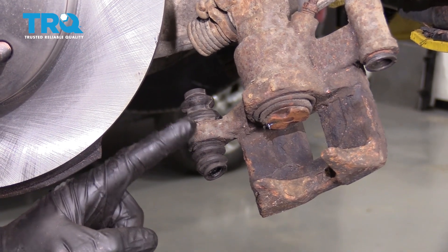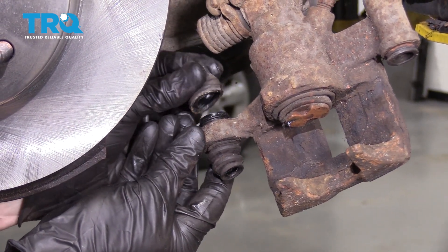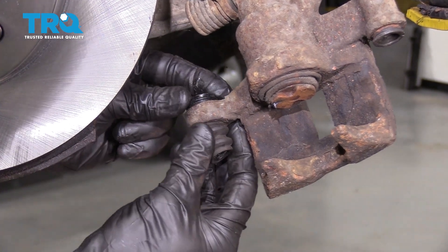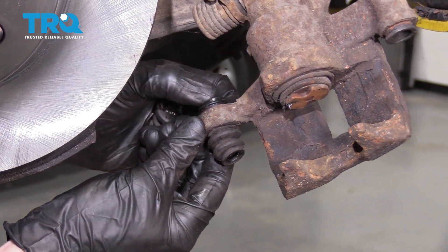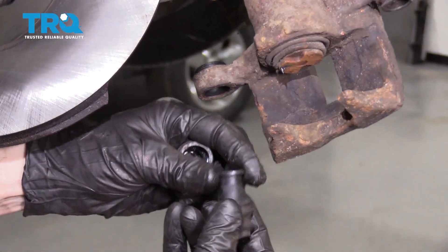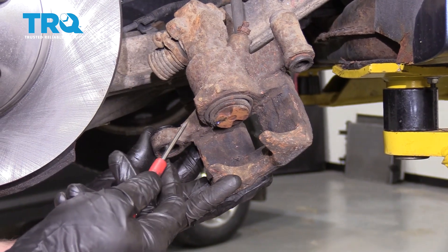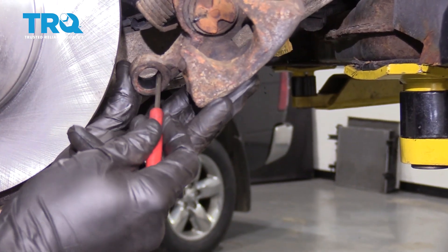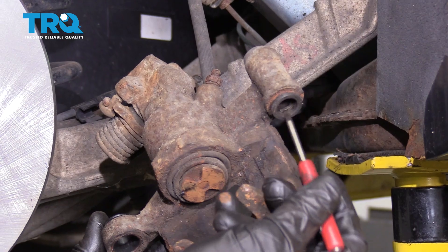Now with the slider pin out, we can continue by removing the two boots for that slider. This one on the rear of the caliper — carefully grab onto it and pull it right off. Give it a quick inspection, make sure it's still nice and soft and pliable, and clean it up just like the other boot. We also have this boot right here that actually goes through the caliper itself. You can feel a ridge of that boot along where my thumb is, so just press it on through, grab onto the lower aspect, and draw it right out. Give it that quick inspection and clean it out. Now let's also try to clean up inside this area — the ridge where that caliper slider boot needs to be — and the same ridge on the other side and inside that port as well.